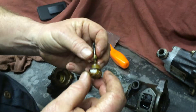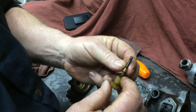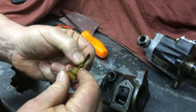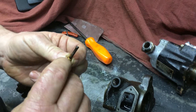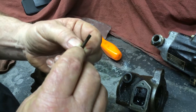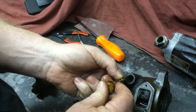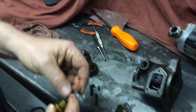Sometimes you've got to take these off because they're broken — this is your indicator light, your ground signal for your oil light. This is going to go down in this hole and pump, and each time pressure forces this off, it'll release this brass contact off of the body and take the ground away from your relay. Then as pressure bleeds off, it's going to push back down with spring pressure, this will touch the body of the unit and you'll get a signal for your relay.